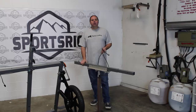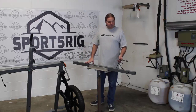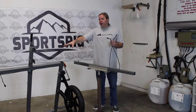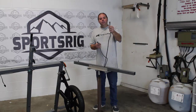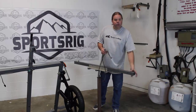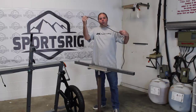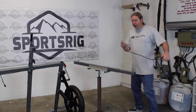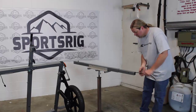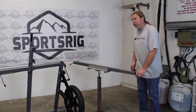If you purchased one of our tongue extensions, this is what it's going to look like. There's a front and back of these, just like the wiring. The frame wiring coming off the frame has the male end — we're going to want to make sure that this male end comes out through the reduced piece here on the tongue extension. The easiest way to thread the wiring harness is to start from the small end with the female side and push it on through.